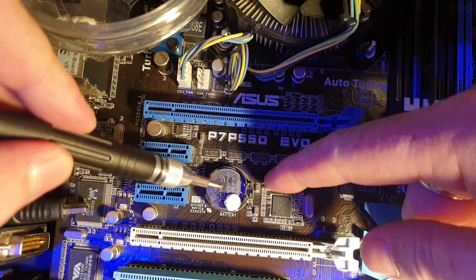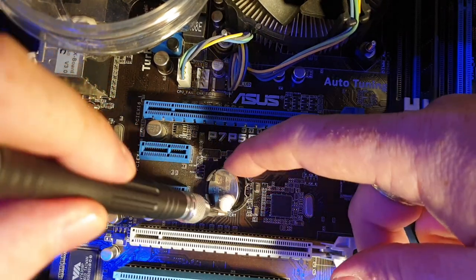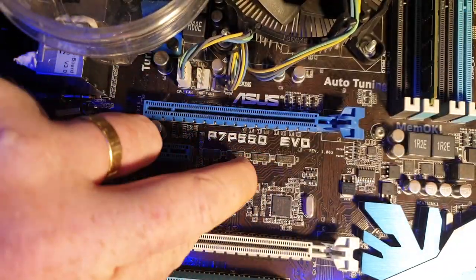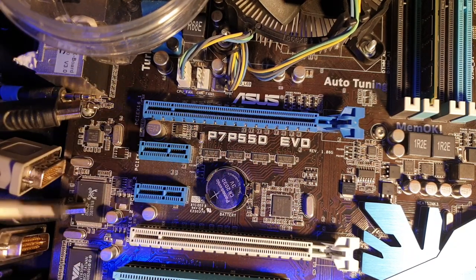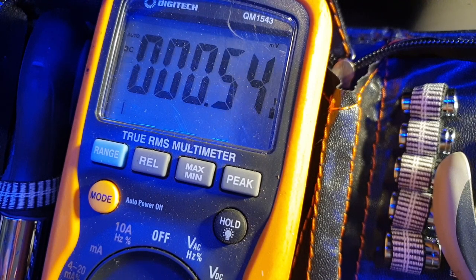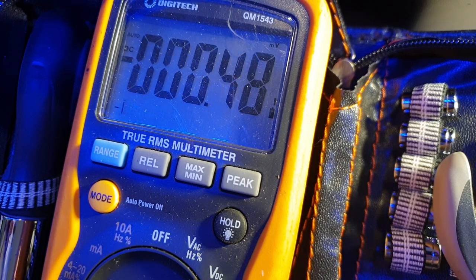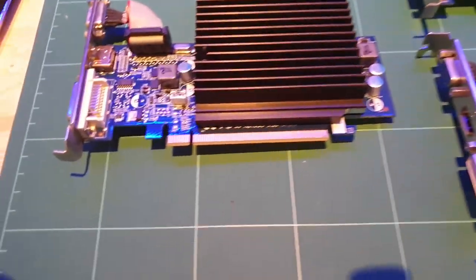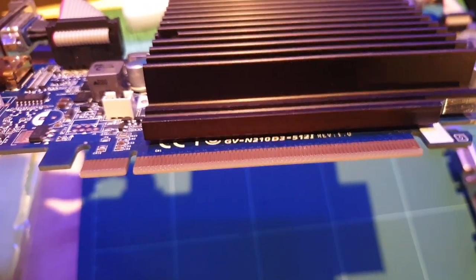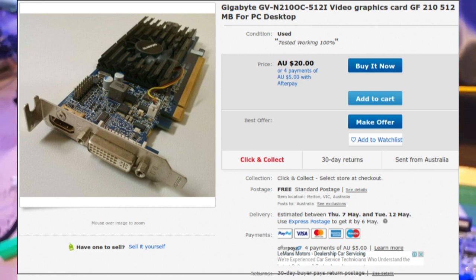While we're here, we're going to replace the CMOS battery. Measuring the old one — 2.1 volts. We're putting in a brand new fresh 3-volt battery, so sweet. These are the NVIDIA GVN210D3 video cards with big custom heatsinks. One thing I noticed: given the VGA connectors aren't being used and the layout of the card frame, removing them would give slightly improved airflow. I'm actually going to be borrowing one of these to fix something I broke.